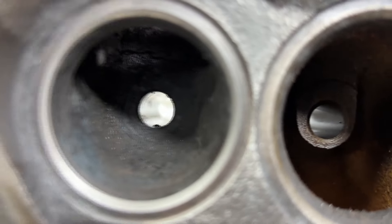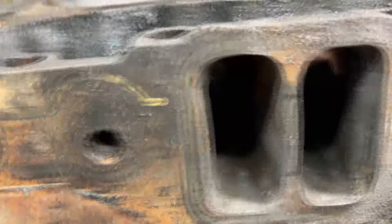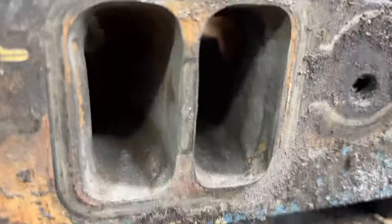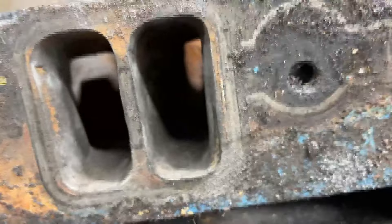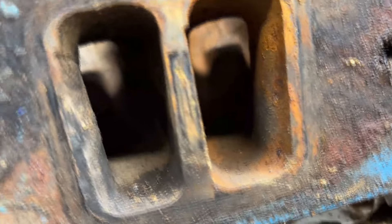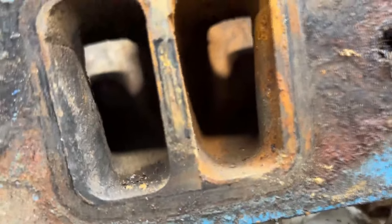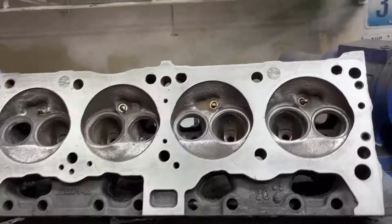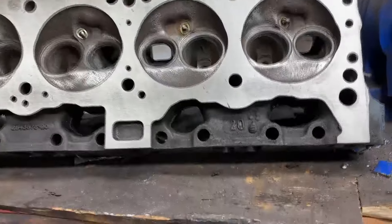Valve-wise anyway on this cylinder — we're not porting the heads, but we are cleaning up all the gunk and the casting flash, just to make them smooth with no hot spots or anything like that. There's the before — most of these just look like gook and goo — you can see all this flash on the inside that we'll get rid of, all the dirt and grime, just to make this run real nice when we're all done.